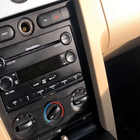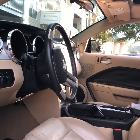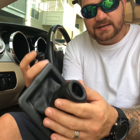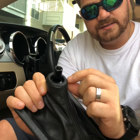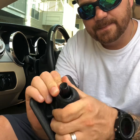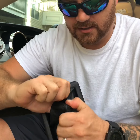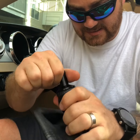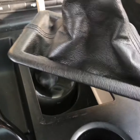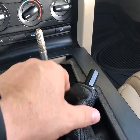There's the grommet holder — we're just gonna lock it into place. You want to take this rubber grommet and push it up through like this. It's kind of difficult — you just gotta push and roll it around the edge, pry it however you gotta get it. It's such a tight fit, but even as old as this car is, this rubber grommet's still got some elasticity to it. There you go — ready to go back on the car. Make sure the direction the boot is facing — you want this part forward, towards the stereo.